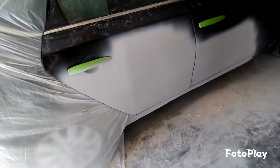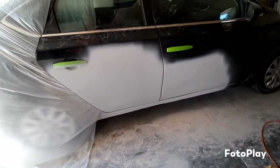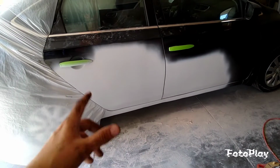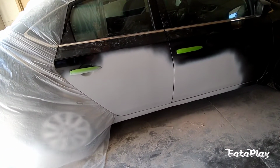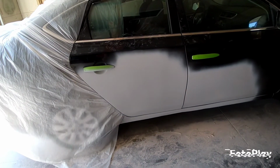So at this moment, on this one, I don't see any bodywork or anything. I put the light towards it, nothing there. I was able to cover it. It took me like 6 passes, I believe, of primer. But hey, it was thin coats, and that ensures me that it's drying and curing well. Because I'm going to leave it out here in the sun for 4 hours. Usually primer takes about 24 hours before you can actually do stuff with it. This one that I got is a fast dry. So I'm going to try to get away with 4 hours instead of 12, I believe.